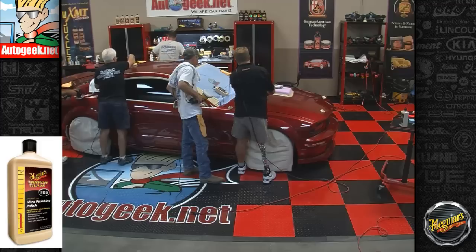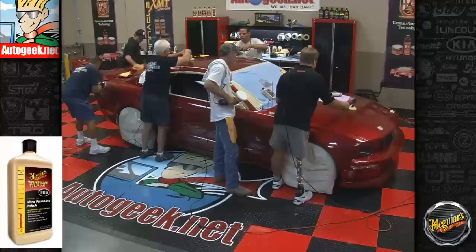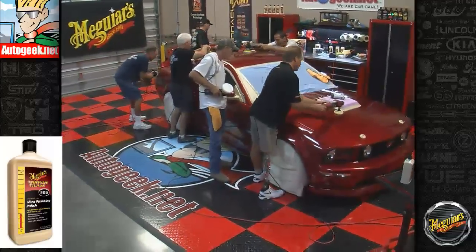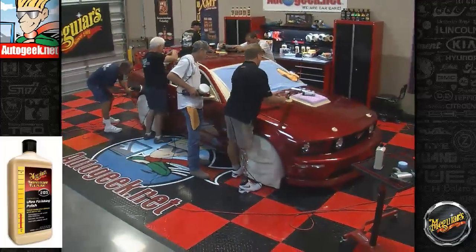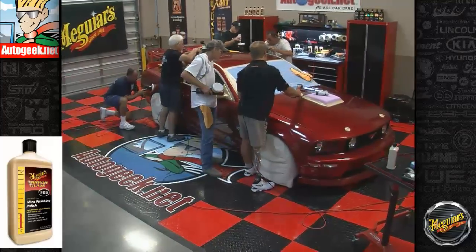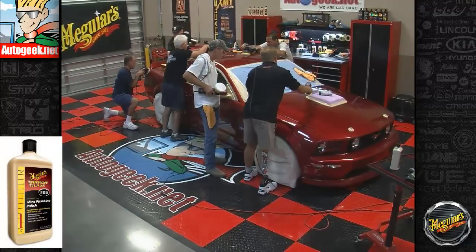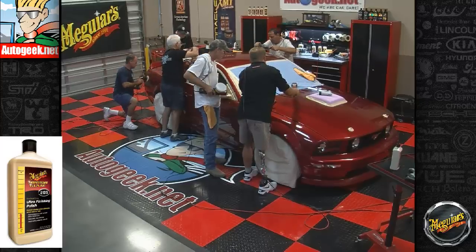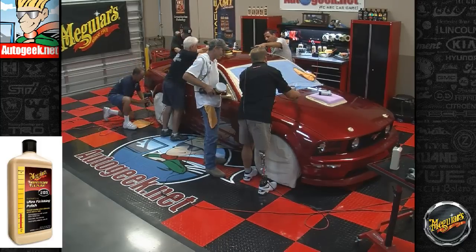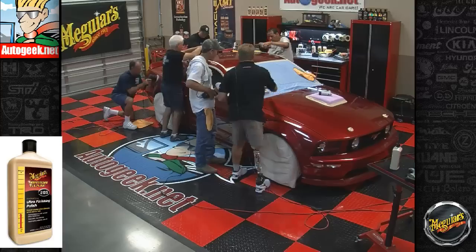No, this is the polishing. There's the weight of the machine, 5 pounds. Look how far it pushed that pad down. So all I'm really doing is just steering this thing. I just want to make sure I didn't leave any swirls from the aggressive cutting pad by repolishing with the polishing pad and the M205. Then I want you to follow me. Your tool will make sure the rotary is not imparting a swirl, because you're using a tool that changes the action. That's why I wanted to go first and have you follow me.